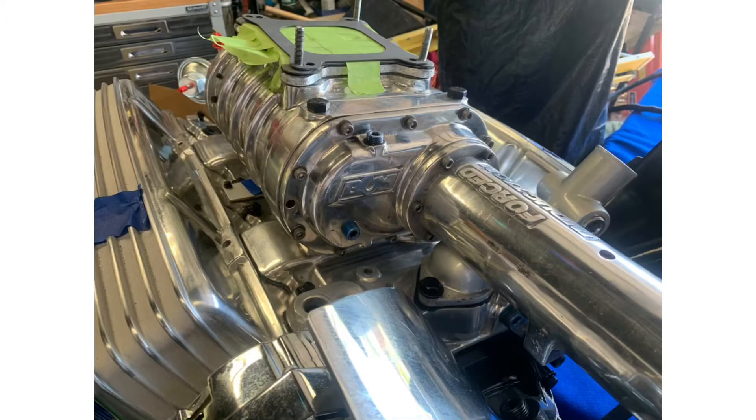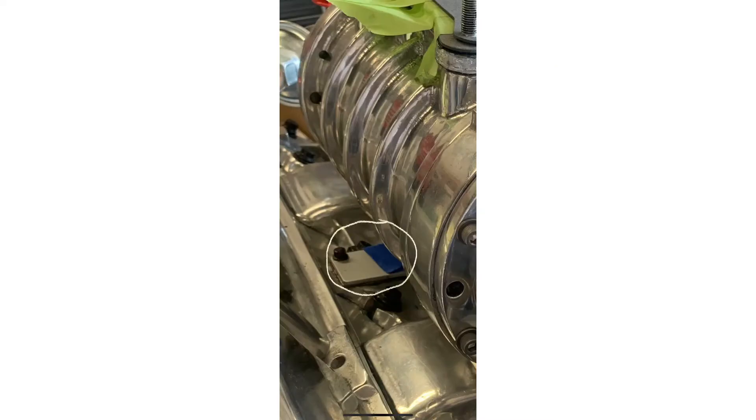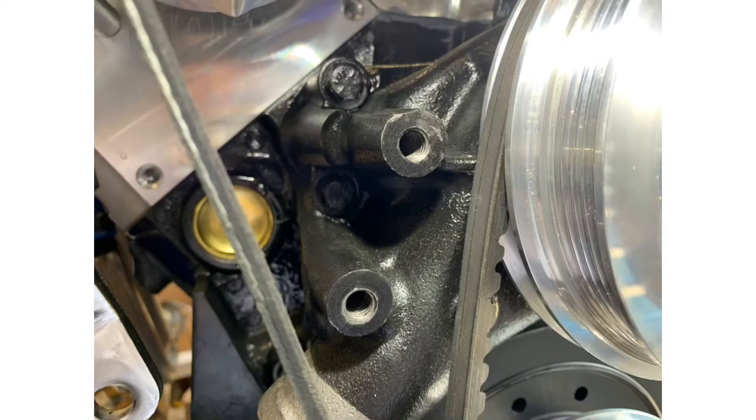Let's start off right here. I had to go ahead and bolt the supercharger down so I can get that plate back there - looking at it left side, the EGR plate - drill and tap a quarter inch hole for the vacuum port. I wanted one there; there is one on cylinder seven, and I wanted one there being it's halfway across the intake, where I can get readings from seven and the overall intake. There it is right there. I did have to take the plate back off to screw the port in - it had to have a 90 in it. You can put a plug in it, but with the vacuum it's not going to work. You're going to do a 90 on it; a 45 will work - I may do that later, but for right now it'd be fine like it is.